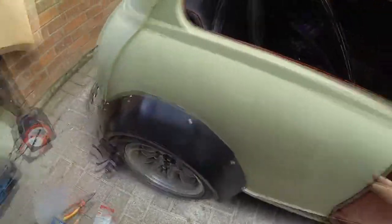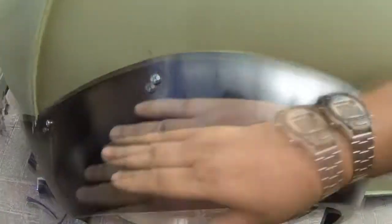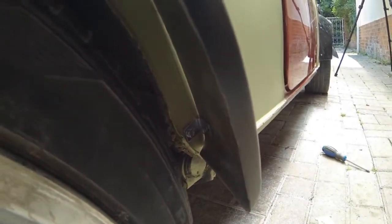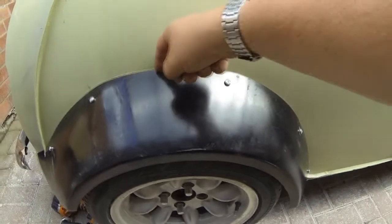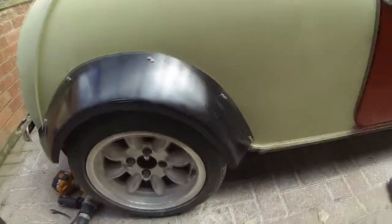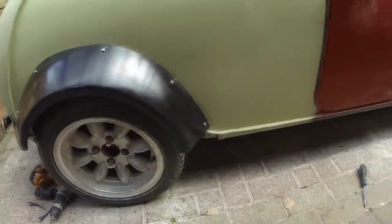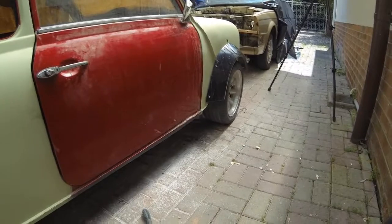I've just got the rear one on. Just to show you how we've done this - Jimmy's gone for the retro look with the fixings showing. If we go under the wheel arch, you can see we've just got some L brackets going all the way around - that's how we've fixed the wheel arch to the car. We got the brackets from a DIY store. There are many different ways to fix these, but we've got a rubber trim to go over the edge, which will make a nice finishing line. They're going to be sprayed black. It's a nice, good fitting, and they've really enhanced the Mini.